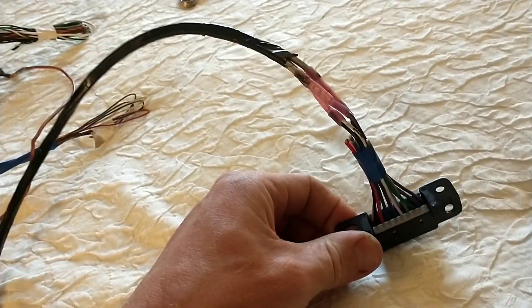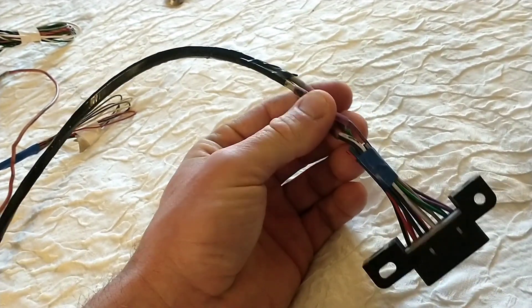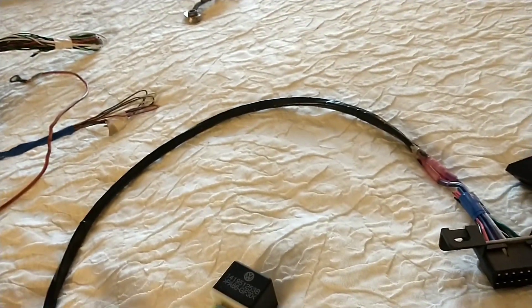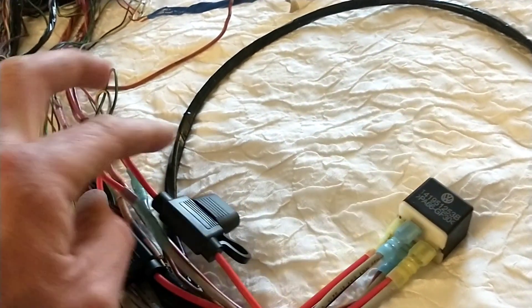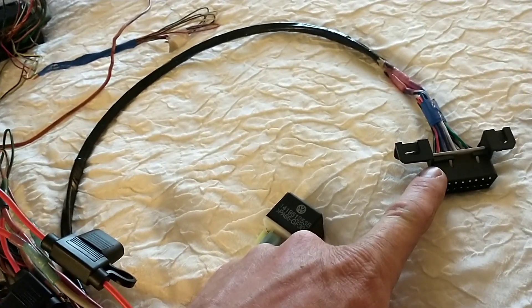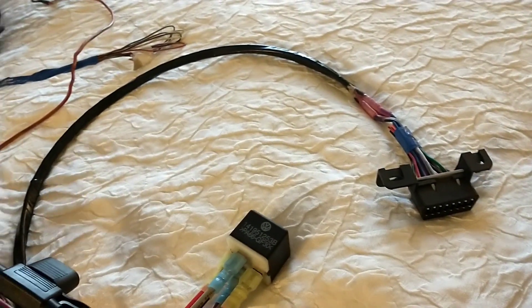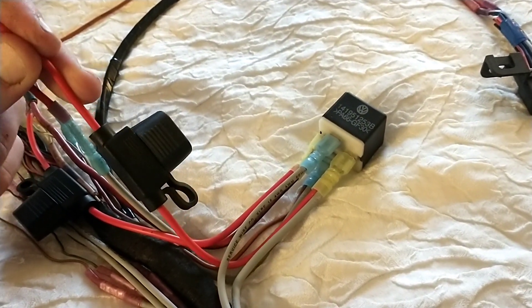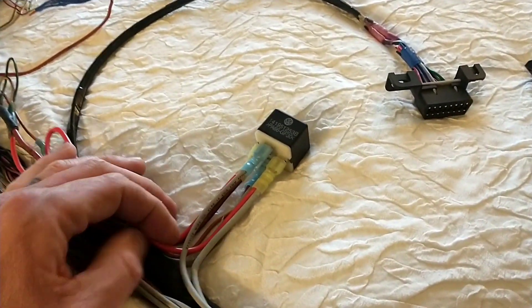The only other fuse you need is for your OBD port. It needs two grounds, a power wire, and the K-line which goes straight to the ECU — you'll have to get the pinout for that from the swap group page. It needs constant power because if you use any kind of scan gauge it's going to save memory. Because of that, I feed it off the main power wire teed to a 5-amp fuse, and that goes straight to your OBD port.